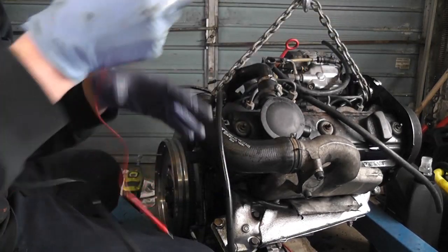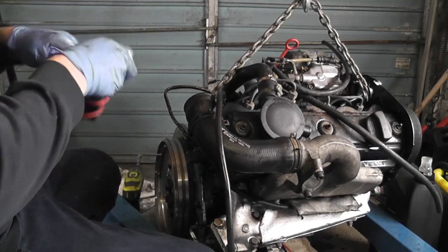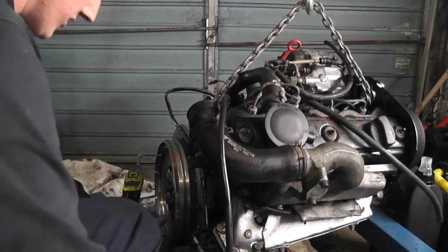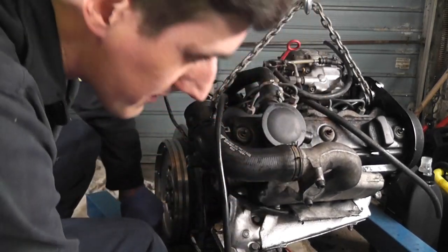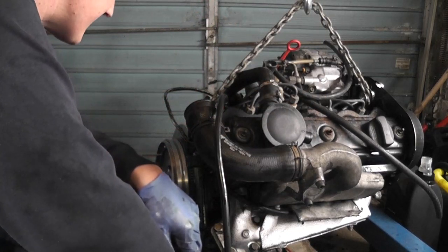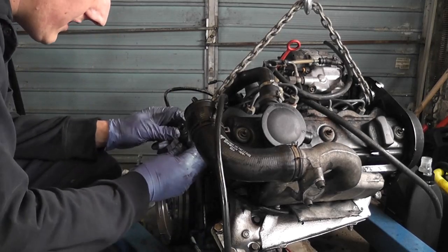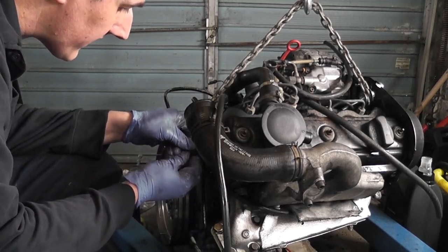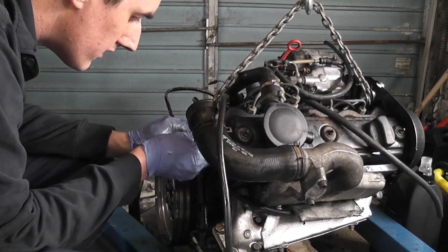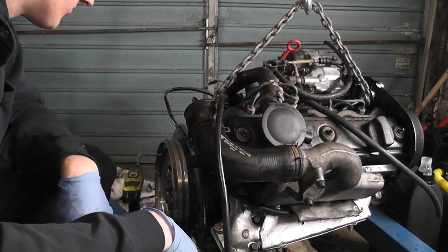Right, okay, so we're getting oil pressure, so that's the first major hurdle now in starting this engine. And you see, it's very important you check these things before you just go and try and start it. I mean, if you didn't have oil pressure and you spooled it up, as we say in the aircraft world, you're going to have a bad time. So, anyway, let's just pop that back on. That's our spade connector onto the oil pressure switch. And that's a good job.